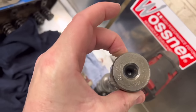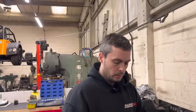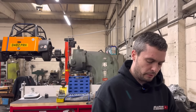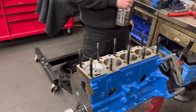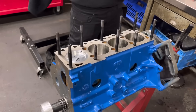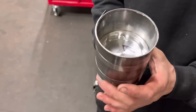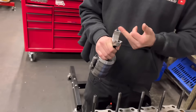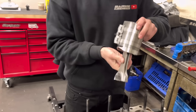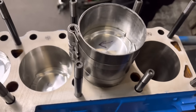We'll work out the compression ratio properly. We've had a look at the camshaft and it is a Kent 264 cam, which in the book is a full-race cam giving about 12.5mm of valve lift. I spoke to the customer and he wants to leave that in there because this engine is going into a fully raced-out Mark 1 Escort — wide arches, fibreglass, plastic windows, the whole shooting match. He wants it nice and peaky. As you've probably seen in previous videos, make sure the rings are offset when you put the ring clamp on, lube the piston and the rings up, and I'm going to plastigauge these bearings but always lightly lubricate the bearing first.